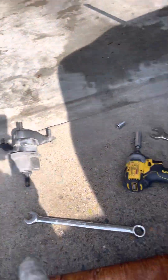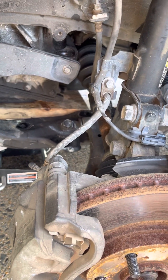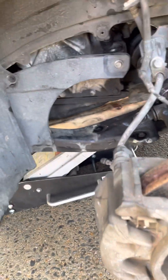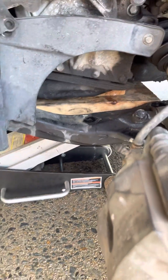I've done a lot of research and I was able to get this motor mount out. What I want to tell you all — you really just have to loosen things a bit. I didn't even remove the torque mount. I could have, but it wasn't necessary. I did take the top nut off the motor mount on the other side so it could lift up just a little bit, because that was easy. I didn't feel like messing with the torque mount, and I just wanted to see if I could do it this way first — and it worked.